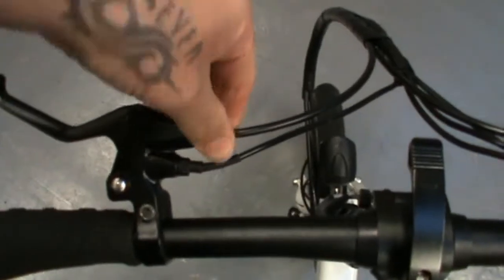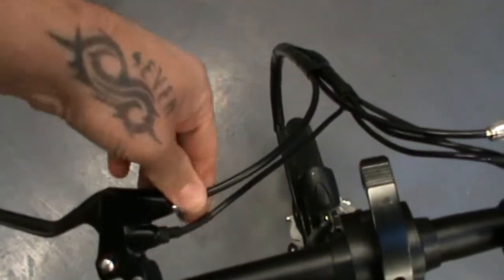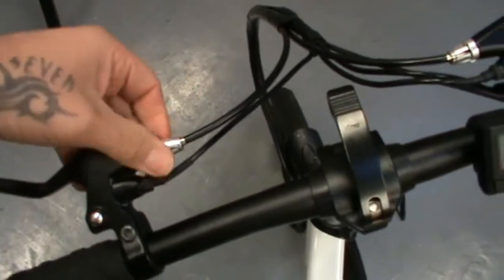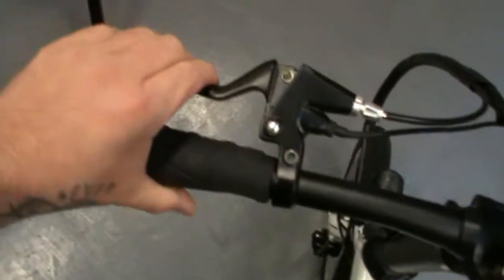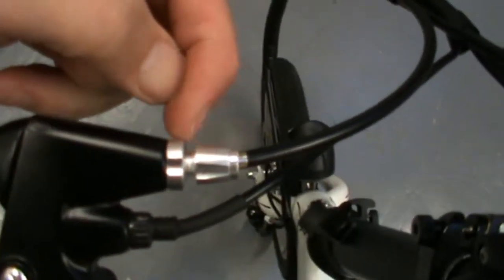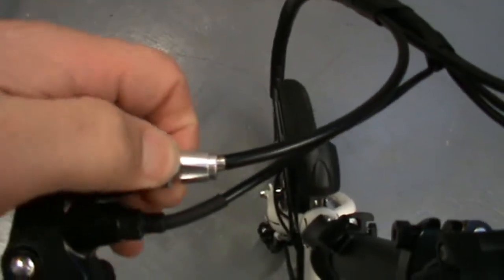The fast way, if you're out on the bike, is to just roll out this adjuster. What that's doing is actually tightening the rear brake caliper cable, effectively just moving the brake pads a little bit closer to the disc. You can see that's brought the brake lever back to normal just a little bit. The issue is there's only so much thread here, so it's really just an adjustment while you're riding the bike.